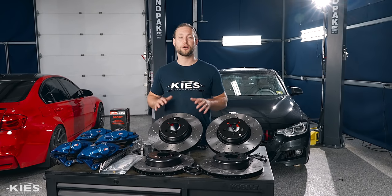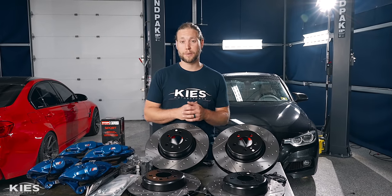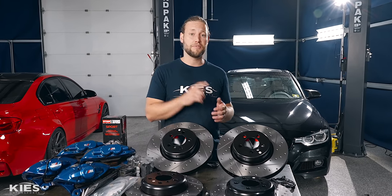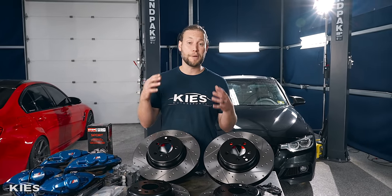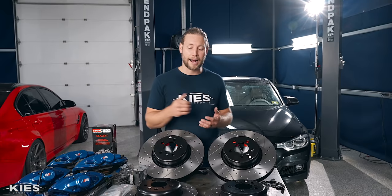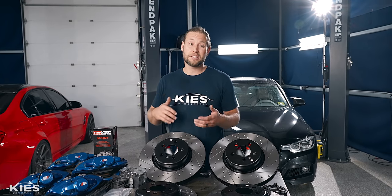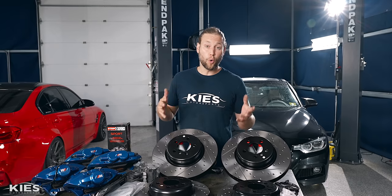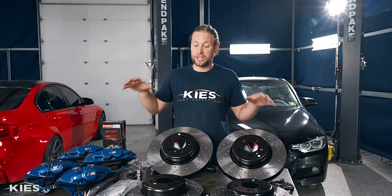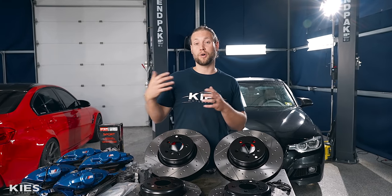We are going to go step-by-step in a DIY for you today, and all the links to all the products will be in the description. The reason we went with this style brake setup with the F80 style calipers is it is a very cost-effective way to get a bigger brake upgrade, especially when you're upgrading the performance in your car. A big brake kit from StopTech, AP Racing, or Brembo is going to cost $5,000–$8,000 or more. But because we started with some used F80 M3 calipers from eBay, this whole package — including new rotors, pads, and sensors — is going to cost about $2,000. So it's about a quarter of the cost.